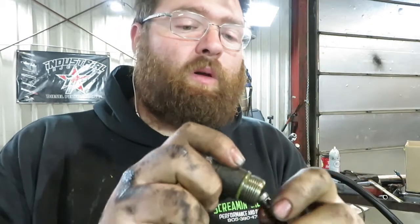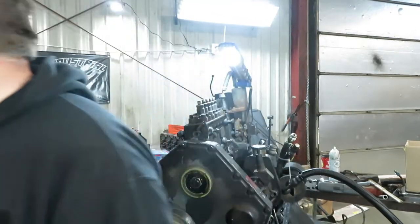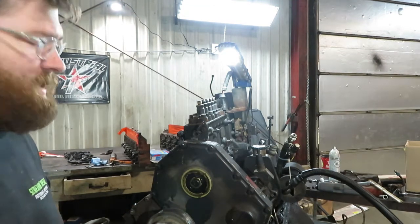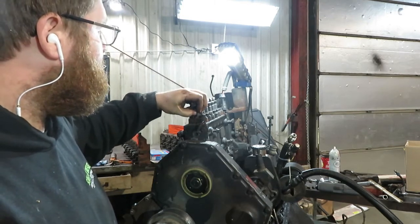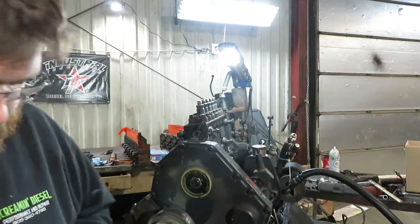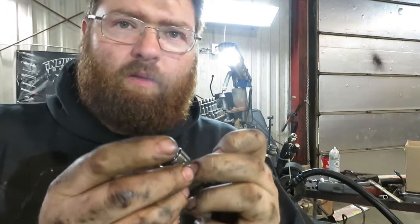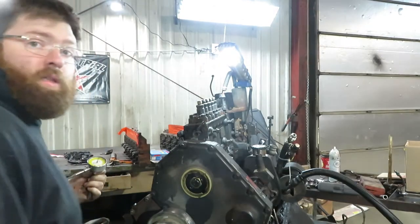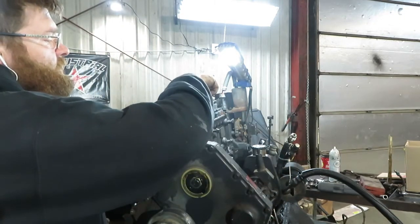What I always do is put the spring and plunger back in the end of the delivery valve so there's no way you can roll them around or lose them, and I also put them in a tray. To get the delivery valve itself out, take a magnet and put it down in there and the whole thing will come right out. That's what the delivery valves look like — put them in your tray.